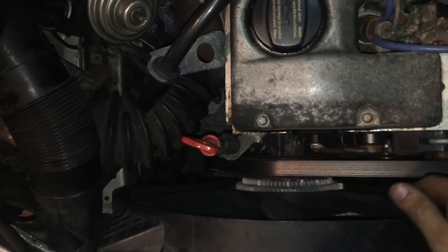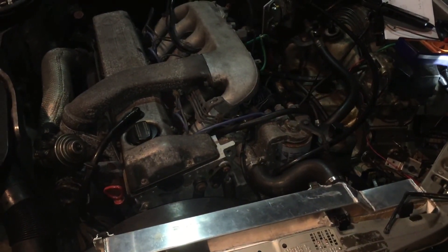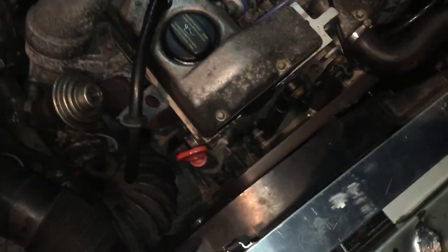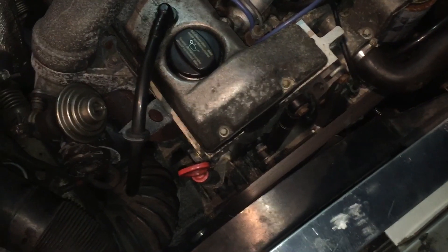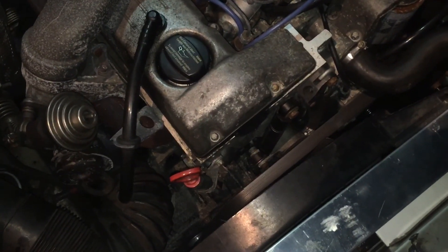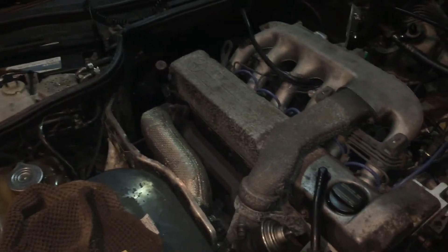I haven't yet decided if I'm going to eliminate the clutch fan. I probably will, and I've got a second small electric fan I can put right here, but for now at least the car will keep cool and the air conditioning should work well. This clutch fan just doesn't perform that well — it takes too long to come on and then stays on too long, sapping power. It must take 15 to 20 horsepower to run. It moves a lot of air but holy cow does it drag the motor down. Anyway, hopefully tomorrow I can finish up the bumpers. Thanks for watching.